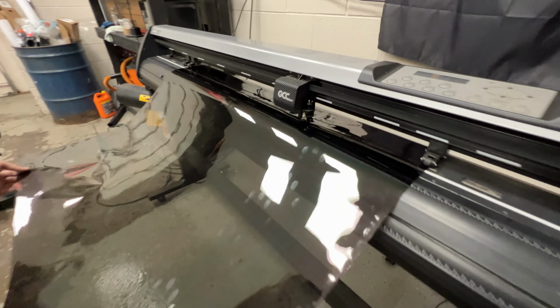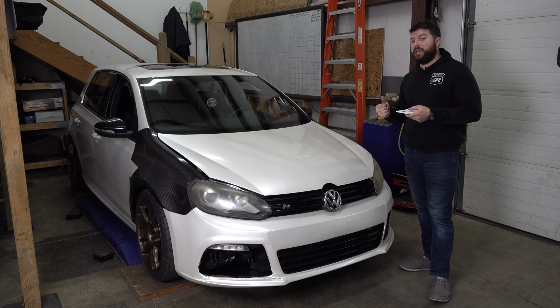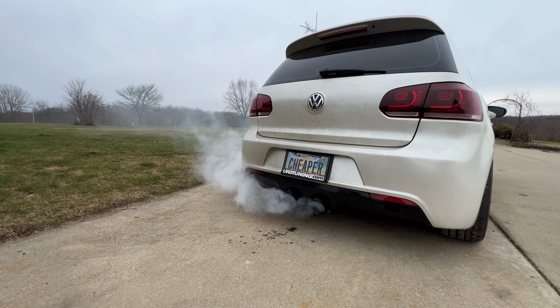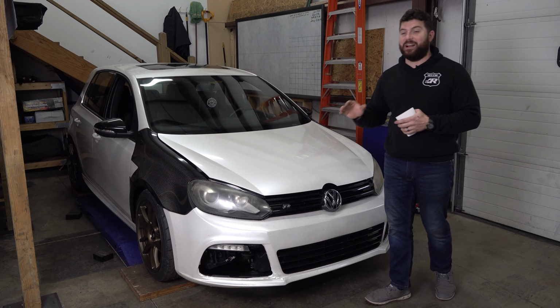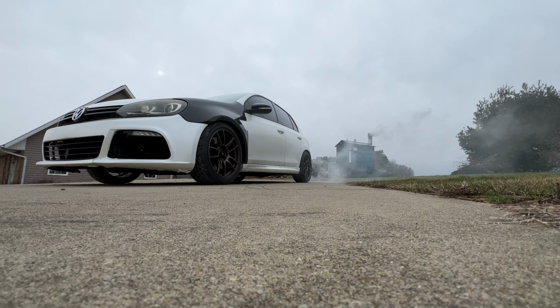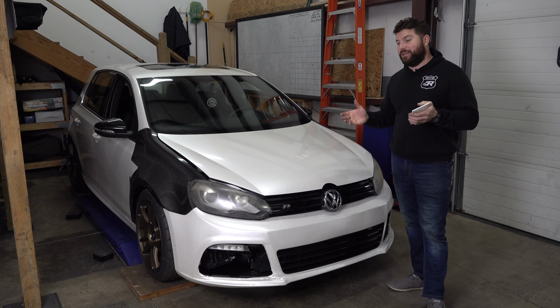This afternoon, our buddies, Mo and Kobe, over at Exclusive Customs are going to throw some 20% tint all the way around. I need to do an oil change. I've got the Liqui Moly kit from UroTuning still. The previous owner did tell me that he thought the turbo was consuming some oil. I think it's a seal in the turbo. If this thing sits and idles hot for a little bit, it becomes a smoke machine. It's pretty bad. But that's the life you get with a big turbo car, I guess.